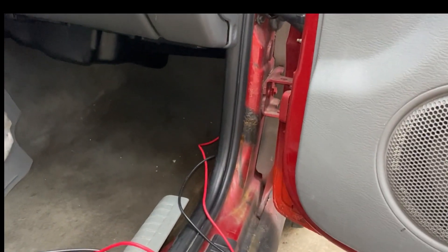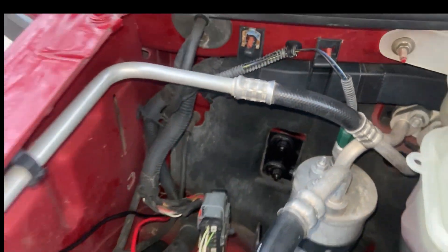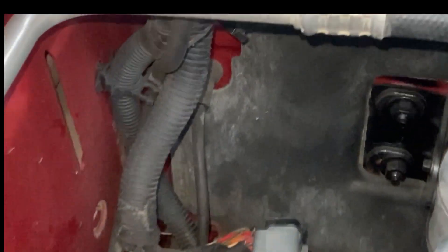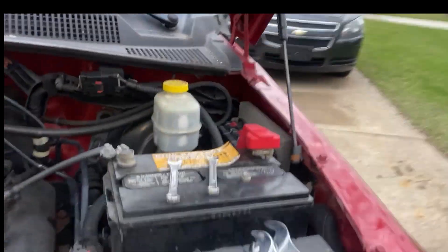I'm going to show you how I routed the wiring through the firewall. Conveniently, on Jeep models produced around 2005 and newer, there are little clips that you can push out in the firewall and push wires through. There is a hole right there — got the wires through it with a little plastic clip. To find that, you look straight down the car and look at the bottom left of the first crevice, and there's the plug. It's not too hard to find; you just need a flashlight. It's a little black clip. The other side on the driver's side is supposed to have one as well.